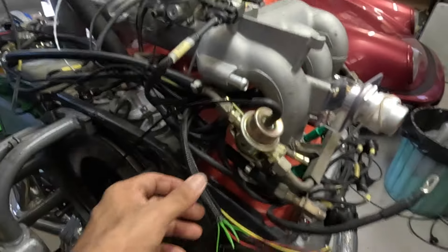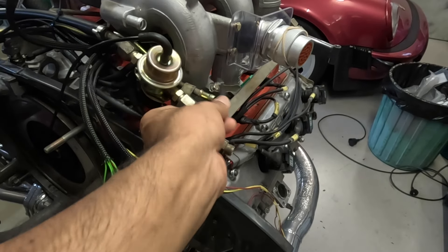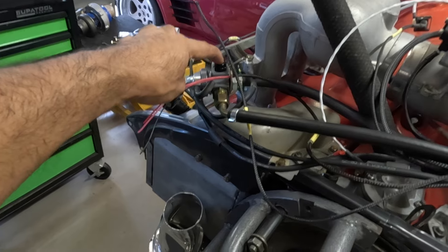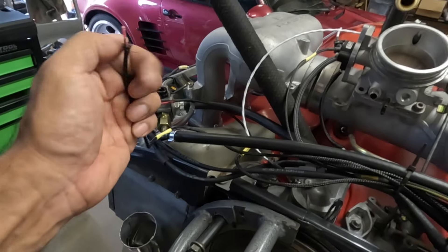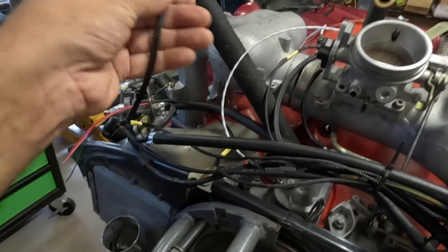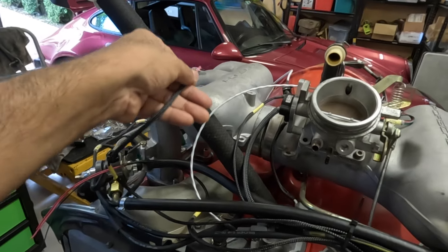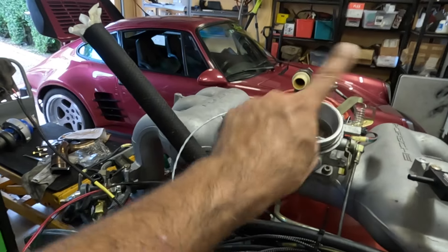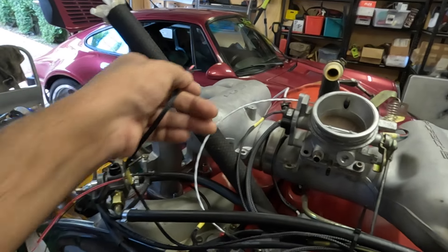The only things I've got left to do: I'm going to have to extend my earth here or just ground it there - that's for the coils. I'm still waiting on the fuel pressure sensor so I haven't terminated that one. This is my intake air temperature sensor - I haven't done anything with that yet. I can go ahead and put a plug on there because eventually it's going to be mounted in the back of some sort of tube that's going to be sitting out here, because the elbow is missing - that'll get some plugs made for the elbow.